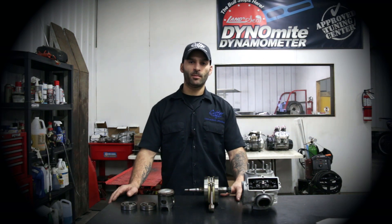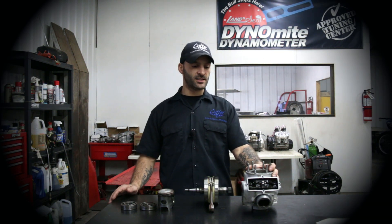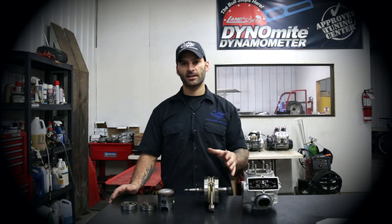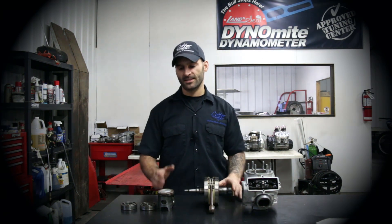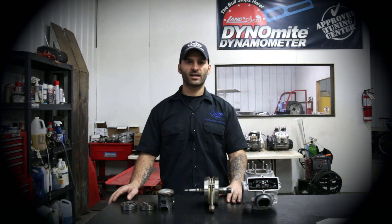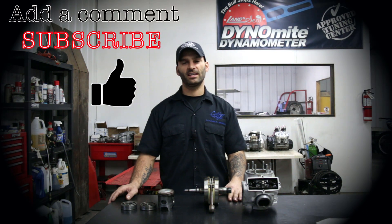So that's it — we took everything apart. Pierre measured the cylinder and made sure everything is all right. The size is good so I can reuse it. I also have a new crank — I'm not going to reuse the old one because it's been in there too long. I just need to order a new piston, new bearings, a few seals, and a gasket. Please click like and subscribe, and leave a comment if you have any questions. I'll see you in the next video.